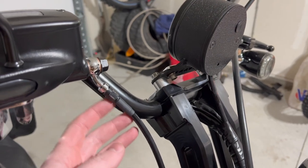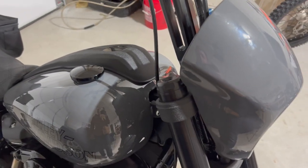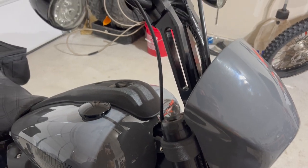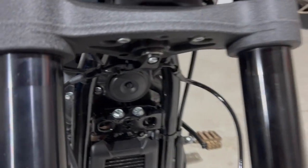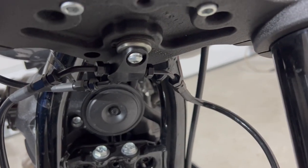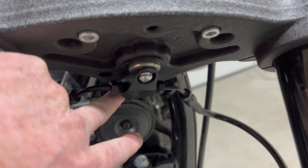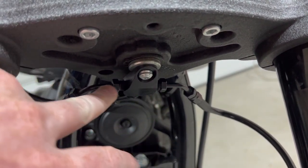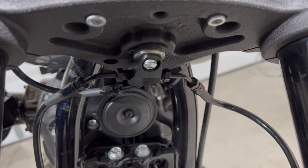The reason is there aren't brake line kits out yet for the 2022s because they do not have ABS. You can tell you don't have ABS by looking at your brake junction — if it only has three lines coming off of it, one to each caliper and one to the master cylinder, then you do not have ABS and you have to build a kit.